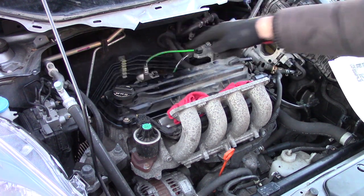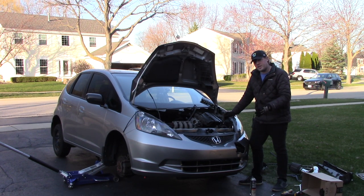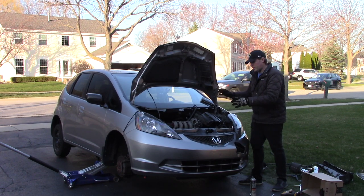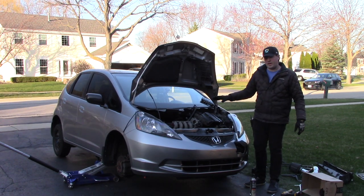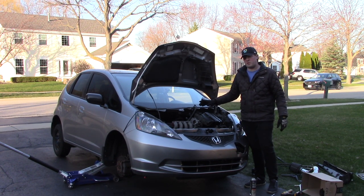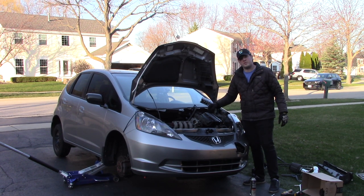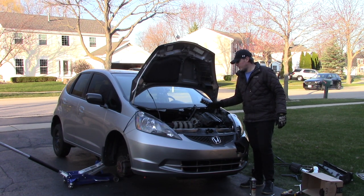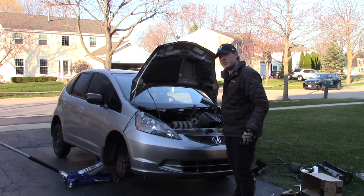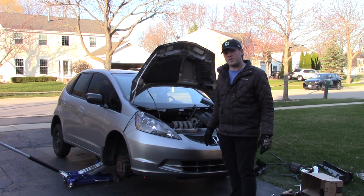Now that we've tightened by hand, it's time to torque them down correctly — that is 84 inch-pounds — and they have to be done in sequence: one, two, three, four, five, six, seven, eight. As you can tell from the lack of sunshine, it has taken the better part of the day to get this type of work done. You should really only use this video as a guide on doing your valves — if you don't trust yourself, have a professional do it because this takes a lot of work, especially for a first-timer. I'm glad you were able to join me as I was learning this whole process. That valve tick was driving me nuts, so I really wanted to get in there and learn this car a little bit more. Now, as they say in those repair manuals: the installation is reverse of removal.